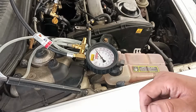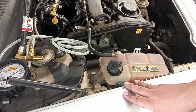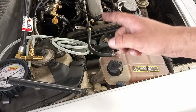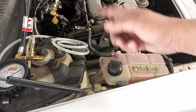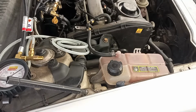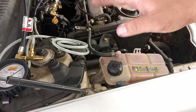Yeah, for sure. I do have a video for this high pressure fuel pump, another case that I had here on the channel. I had fault codes for the high pressure side, okay? I did test this high pressure fuel pump, but the car at the time did not start, just cranked. And when cranking, I have there the 300 bars on the fuel pump. But that does not mean that right now, with your engine running, it can maintain that pressure.